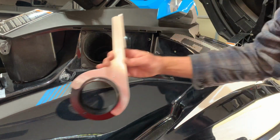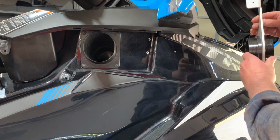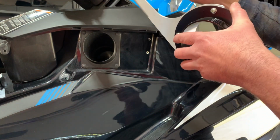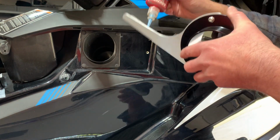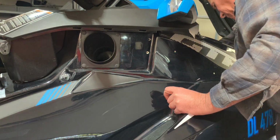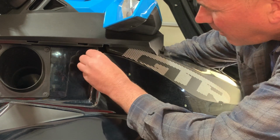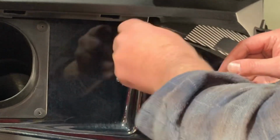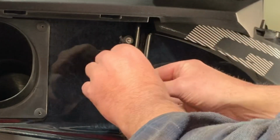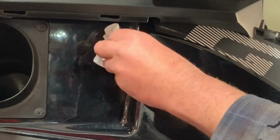Now this is the air filter assembly. This is where the air hose attaches on one side and the filter to the other. So this is the whole purpose of us drilling holes into the side of the ski. I did use Loctite inside the holes before I mounted that. It's definitely a better idea to mount the air filter and the hoses before installing this, unlike how I did it. When I put the screws in, I actually added RTV to the sides of the screws, just because I didn't like the idea of the screws rubbing the sides.